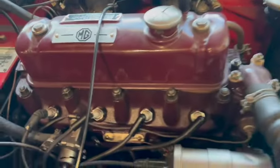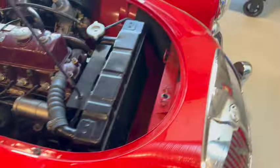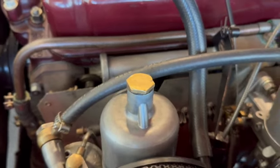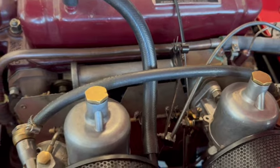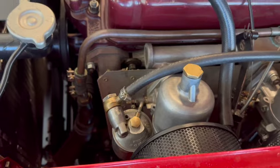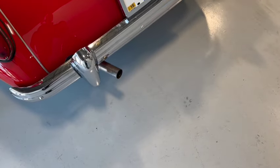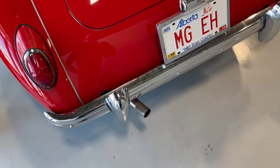Let's just look at it - it's running very sweetly. There are no unusual noises, just a little bit of normal tappet noise, no knocking or anything as you'd expect. And the tailpipe - it's running nicely, not overly rich, and there's no evidence of it burning oil at all.